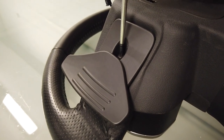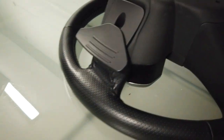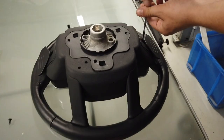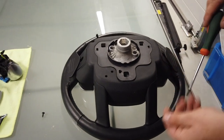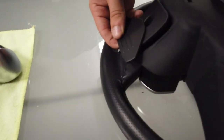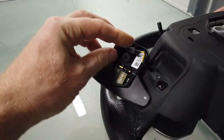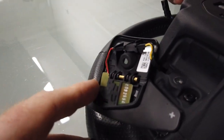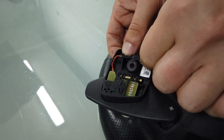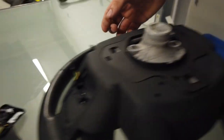On the back you've got some little Torx screws — I think it's a Torx T15 but don't hold me to it. There's a little screw — it's not quite a coarse thread. Whip the other one out as well. Now pull the paddle shifts out but there'll be a connector on it. There's a little press bit at the back — press that and it releases. Do the same on the other one.